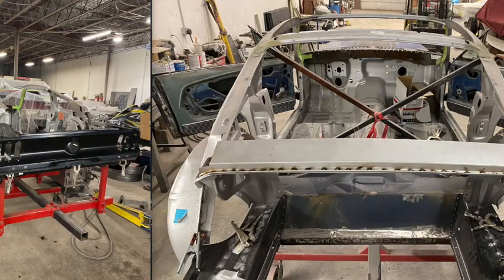At this stage in the build we have the unisides clamped and welded. I know they're in the right spot — got them lined up with the upper cowl and the inner rocker panel. So I know they're lined up and ready to go where they need to be. The next stage is getting the crossbars for the roof support welded into place.